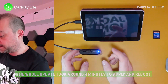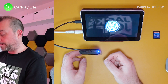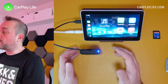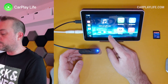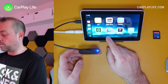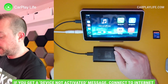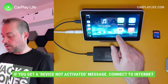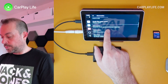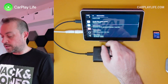It's now stopped flashing and we've got the dongle booting up - Android is now starting back up. They did tell me to do the wipe data and format flash, but if you do that you're going to lose all the applications you've already installed, which isn't great. So I haven't wiped my data. We're going to quickly get connected to the internet. Now we go into settings, scroll down to About, and here we've got the 2022 February 22 update that has been applied.